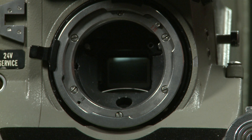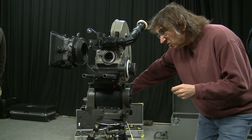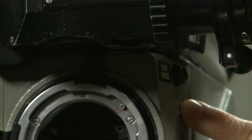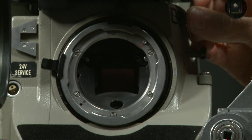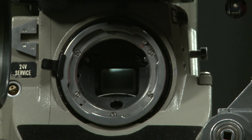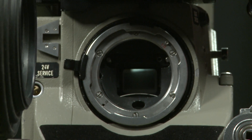When the camera is off, it stops with the reflex viewfinder mirror sending the image from the lens to the viewfinder rather than to the film, so I can look through and frame. There's a little button called 'dust check' — if I push it, it exposes the film, the viewfinder goes blank, I can check the gate, and then come back. An easy way to check for dirt without wasting any film: take the lens out, check, pop the lens back in.